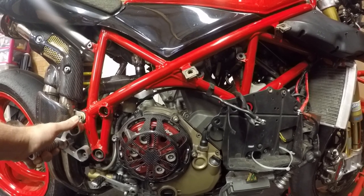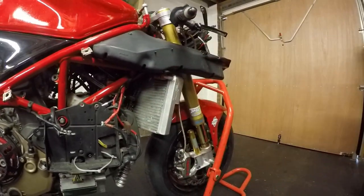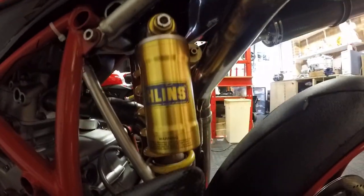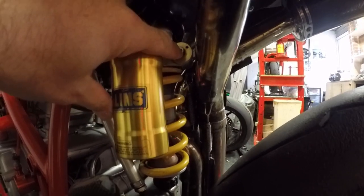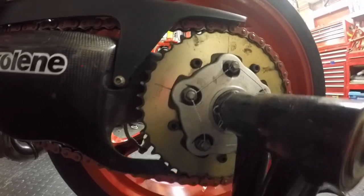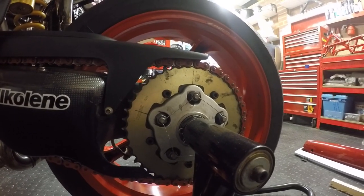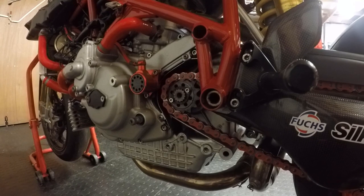But this is the bike that I won two championships on in this chassis and suspension configuration — it was a pretty good bike for me. We've got one of the later Öhlins shocks with a hydraulic preload adjuster and high and low speed compression damping and rebound adjustment. I run a 520 chain conversion with Talon sprockets and a 44-tooth rear sprocket, primarily for acceleration.